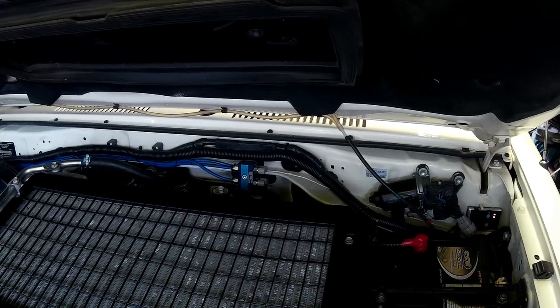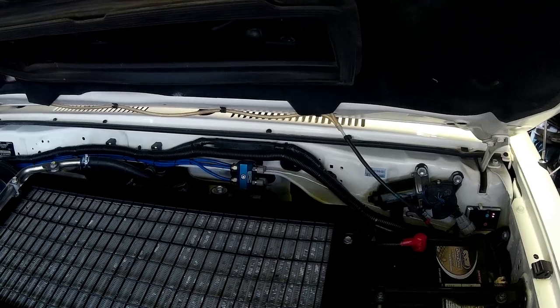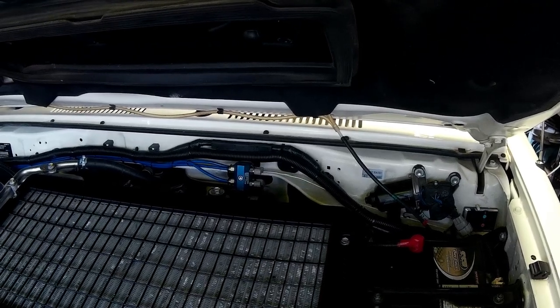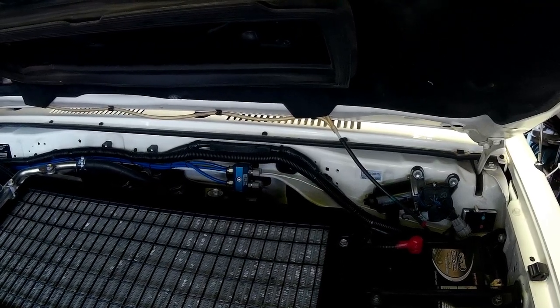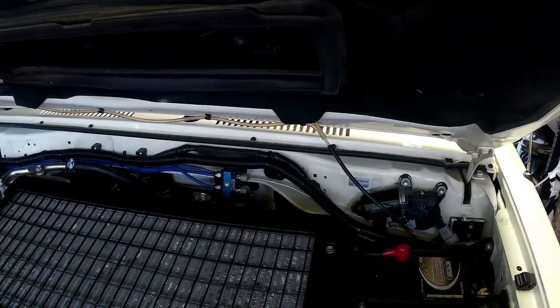It's really providing breathing for six different items: front and rear axle housing, front and rear diff lock actuator, the gearbox, and the transfer case. I've just teed into the front and rear differentials.